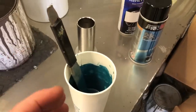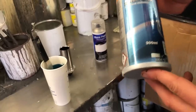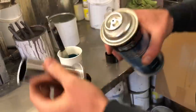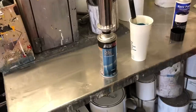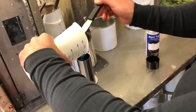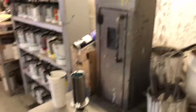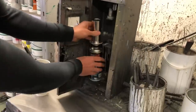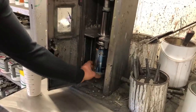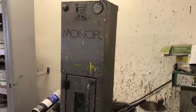He's mixed all that paint up now and we're going straight back to Sam. Basically we've got our can which we're going to use - this is just a blank. This only contains thinners and hardener. Now we're going to take the lid off, take the nozzle off the top, put the cartridge that the paint needs to go on on top - it's got a hole, we put it in there like that. All set up and ready to go. Now we're going to pour the paint into the cartridge. That's all in. So now we're going to put it into our monofil aerosol machine, which we open up.